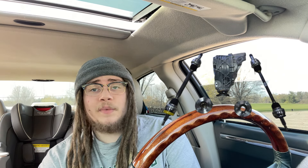Now we need to talk about putting that power down reliably. A limited slip differential lets you put power down more efficiently through both tires rather than one. The open differentials these cars come with put power down through the tire of least resistance — they take turns. You're going to lessen wheel spin and improve traction greatly, get off the line quicker, and put power down better from a roll. All of your ETs are going to improve: your 60 foot, your zero to 60, your launch. Even from a 40 roll, you're going to feel the power delivered more smoothly, more quickly, and a lot more aggressively. You need a limited slip differential, especially since the 392 scat pack comes with one from factory.